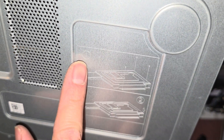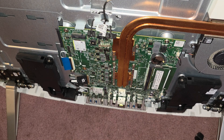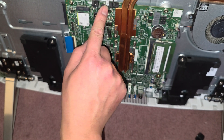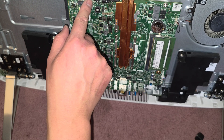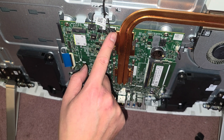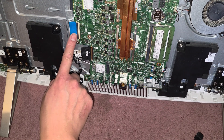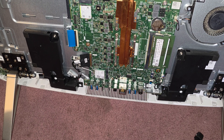We've got this box off. And you can actually see here — they show like instructions. It says take this off first, then take out the four screws. You've got the camera connector right here, a little connector going into the screen, and this one says for touch, this says for webcam — they actually label it. And this says for BL, which is probably the backlight for the screen. And then this one is most likely for the screen itself — the LVDS cable.